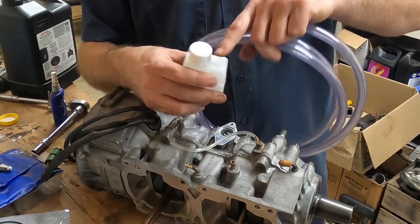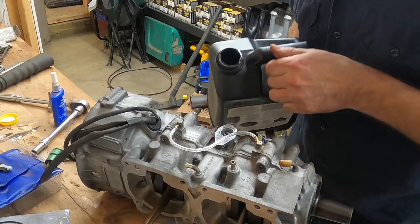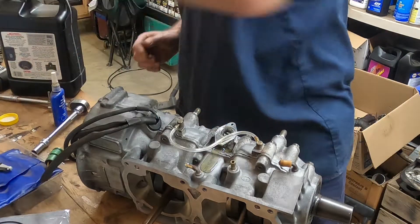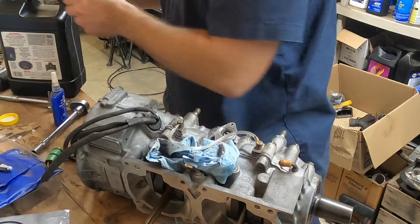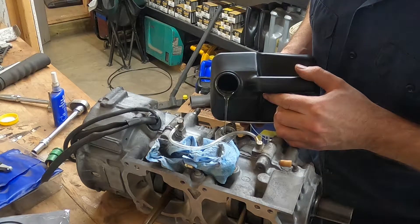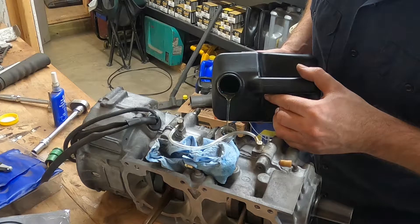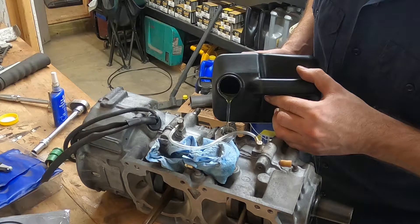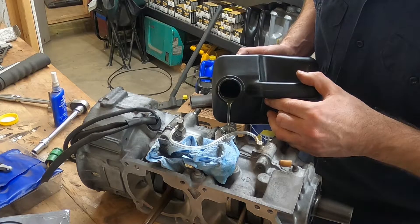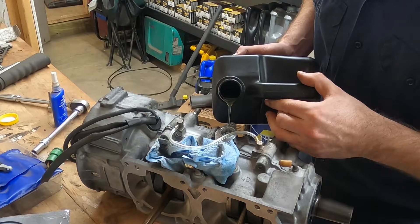Because you don't want to spend days filling it up through this bottle, I'm going to go ahead and put oil in this area to start with. I'm probably going to make a mess because this is a really full bottle. This will take a little while because there is a bearing that's going to slow the oil running in there, but as I pour this it will run down through the bearing and fill that entire cavity up. If you don't fill this cavity up, there are some bearings for the water pump and water pump drive that will get destroyed. There's a plastic gear on the crank that runs on the crankshaft, and there's also a possibility you could damage the crankshaft as well.